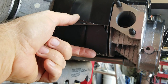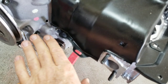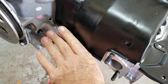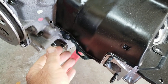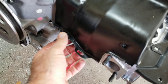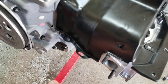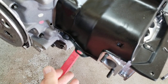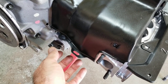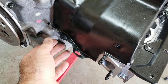So if you can deal with these small holes here and the back tin on yours will just overlap and sit there and it doesn't bother you, you don't totally need those. You can actually still put them on, but you may have to bend them a little bit so they're not just going to bolt right on. It's just like if you get some of the Chinese tin or Brazilian tin and try to put on a German tin, it doesn't fit quite right. You have to tweak everything. You can get them to work, but you don't totally need those anymore. You could actually put a nut and washer here if you wanted to, and that'll probably settle it.